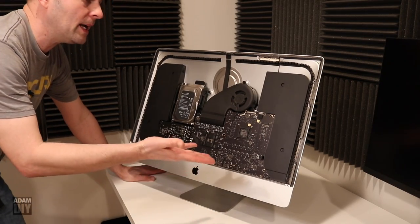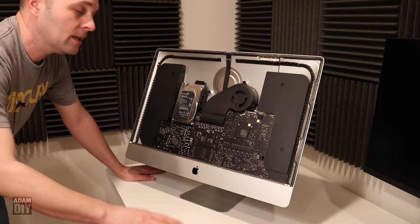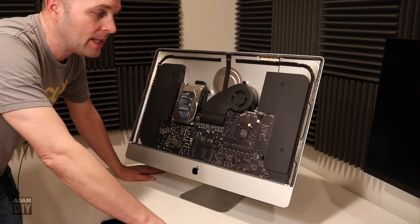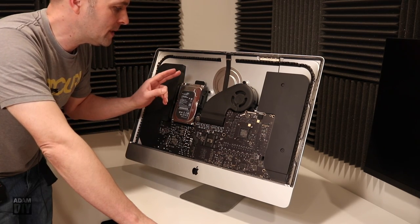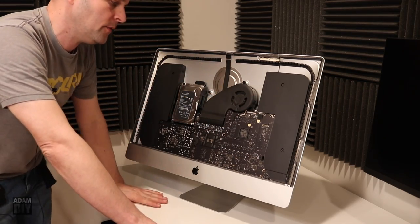For the record, my issue with this machine is that I cannot get past the password screen. When I log in, I type in the password and it locks up — the whole thing boots, everything. I've reinstalled the OS, I did the PRAM, all that kind of stuff — I did everything. So hopefully I swap this out. I'm going to put in a solid state drive, and maybe this old drive goes in an external so I can try to pull all my information off.